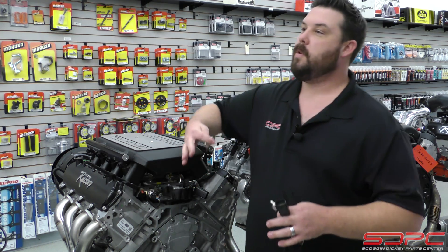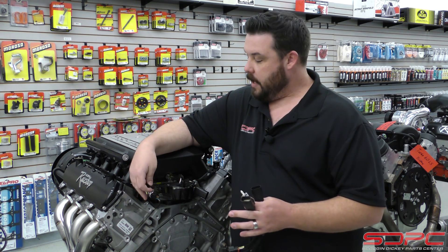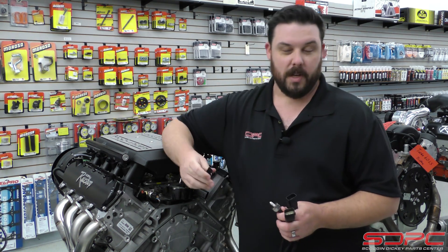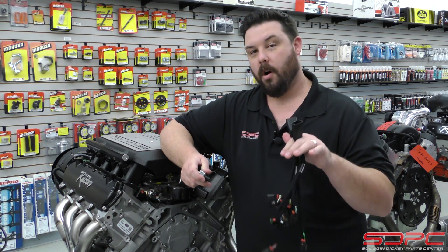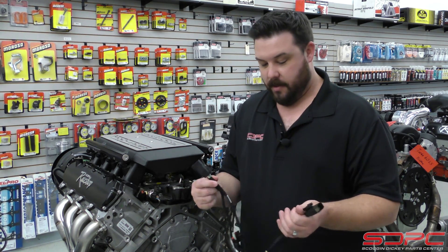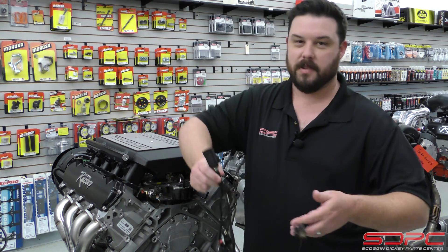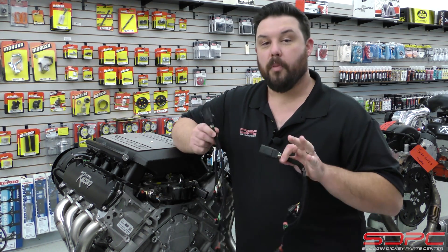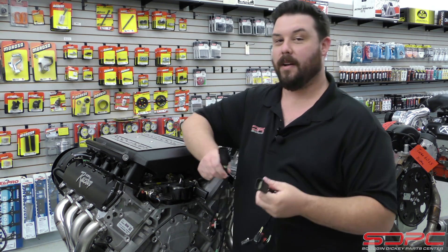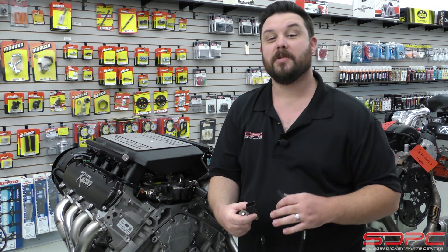You can swap these out. So if you went to the junkyard and picked up a 5.3 or a 6.2 and you're trying to control it, and you have a 4-pin sensor but the controller needs a 3-pin sensor, it is changeable. We'll be giving you the part numbers on the sensors and the harness. You do need to change the harness — don't try to re-pin it, don't try to find a shortcut. These are relatively inexpensive brand new from GM. They are the same for cars, trucks, the CTSV, the Vette, and the Z06. You'll notice there are some extra plugs on them because it handles the sensor as well as the driver-side bank of fuel injectors. So it is important that you change this and don't mix it up.